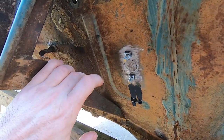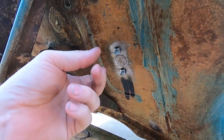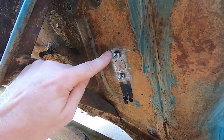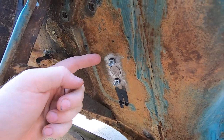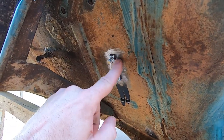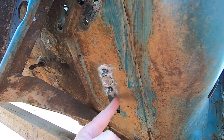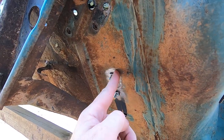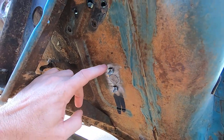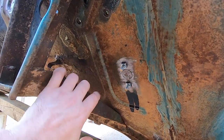They're CAD plated. What I like to do is put the nuts on bolts, just run it on a couple of threads backwards. The flat part that actually meets the toe board here, I take a wire wheel on the bench grinder to it, clean off the CAD plating on the facing edge and on the sides. Then I'll bolt it on here so they're kind of straight, and put a couple of stitch welds on each side of the square nuts to lock them down. Normally I would use some 3M weld-through primer, spray some on here so the nuts would be on there and it won't corrode behind them.